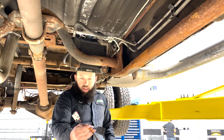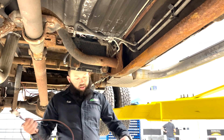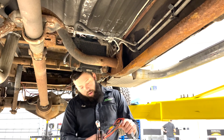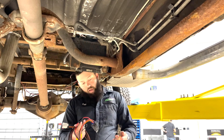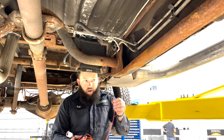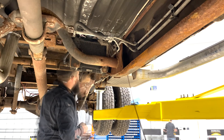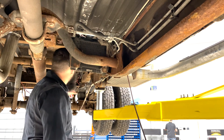These two four-pin connectors are going to go up over the tank. The rest of this is kind of like a harness — we're just going to give it battery power and ground. There's a fuse in here, a relay, and an add-a-fuse link right here. You're going to find an ignition power source so when you flip the key on, this thing stays running. I'll just hang that roughly where the sending unit's going to be.